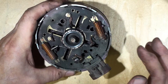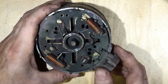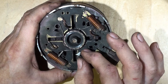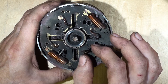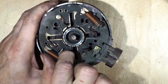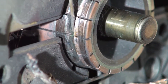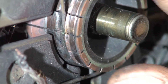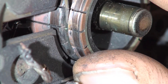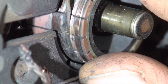You've got a couple of chokes here which are for RF suppression - there won't be significant impedance at motor running speeds, it's purely to stop noise. These stubbies - little stubbies - are actually the remains of the brushes. The most complete one shows it's a slotted brush that runs in a slot guide, with a tension spring to hold it in position. Zooming in on the commutator - you can see the brushes are completely disintegrated, and it's actually been running on the wires; the spring wires have been acting as the brushes.